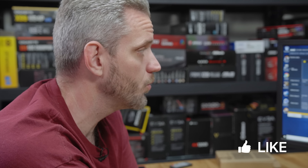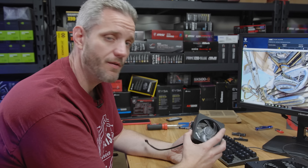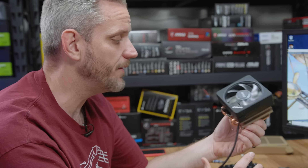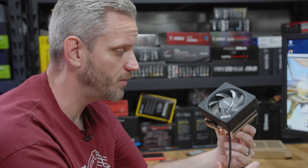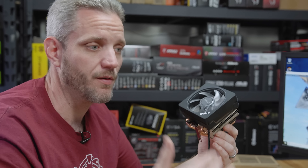I did not expect it to be within 5°C of the Noctua cooler — I really didn't see that coming. If you're looking to do some minor overclocking with your Prism cooler on your 2700X, it's definitely capable. And as you go down the stack with fewer cores, the cooling only improves. This is also a worthwhile cooler for any AM3 or AM4 CPU.